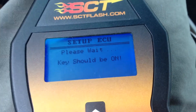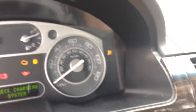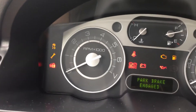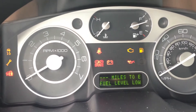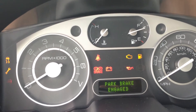Before you do this, make sure your OBD2 port is plugged in really well. Then it's going to start downloading — this freaks everything out. This freaks the instrument cluster out, your airbag light starts flashing, it says check charging system, and your PATS light, your anti-theft light goes crazy. When I did it the first time, my TPMS light started flashing and it said TPMS system fault. It doesn't do that on subsequent tunes.